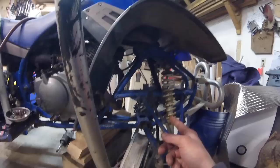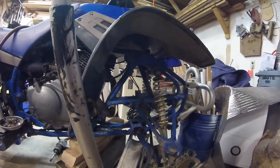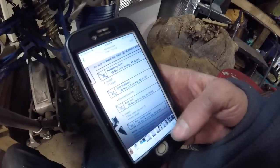The other brake pad is giving me some trouble. Basically, I stripped the bolt on the caliper because I was rushing. So, yeah. But I'm going to torque these axle nuts. I actually have the specs while I'm thinking about it. I'll tell you what they are because I always forget to put them in the description. This is from the manual itself. The rear wheel axle nuts are 85 foot-pounds. And the actual lug nuts that hold the tire to the axle, those are 32 if you want to torque those. The front axle nut on the front tire is 61 foot-pounds. And the lug nut is 32 as well, same as the rear.